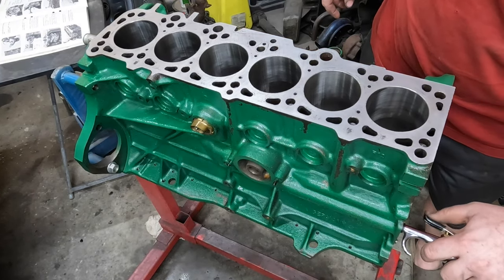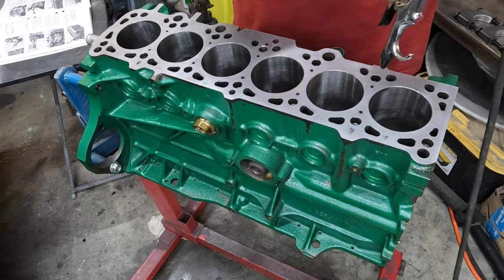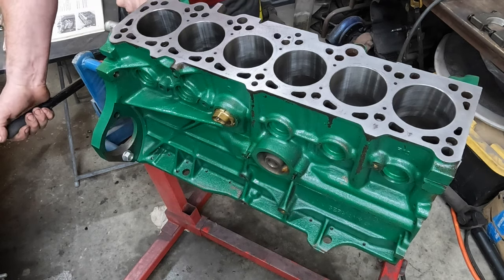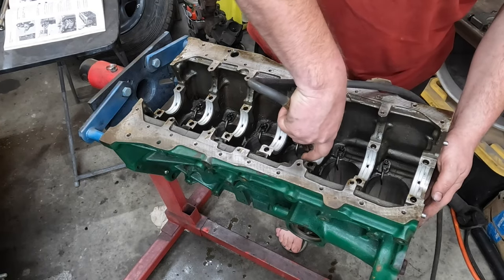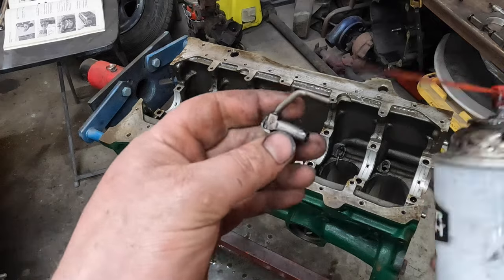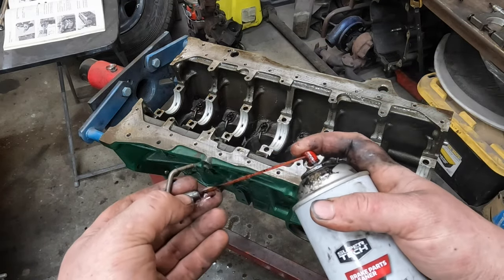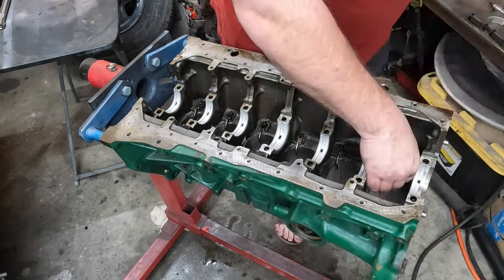Blow through the oil pump passages. If you have a D24T, you also have oil squirters down at the base of the cylinders. I need to turn it over anyway to check the main journal oil passages, so I'm going to pull those squirter nozzles off and see what I see. There is a little valve in there — I assume to prevent oil from draining back down through the head when it's off — and I can see it's working normally. Make sure this passage is free. Now that our block is ready for the crankshaft, we need to check these oil passages as well.